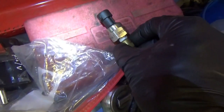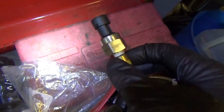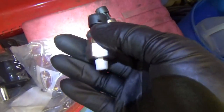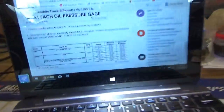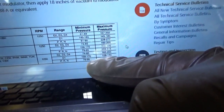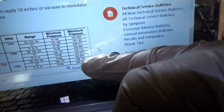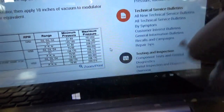Be careful — double-check your transducer values. This one's actually a vacuum transducer — my bad, 30 PSI. The highest one I have in regular pressure is 200 PSI, so we can still do the check. The only scenario where we might max it out is on P/R/N maximum pressure, but the minimum pressure is still well within 200 PSI, and the maximum in the D ranges should still be below 200 PSI, so it should be okay.